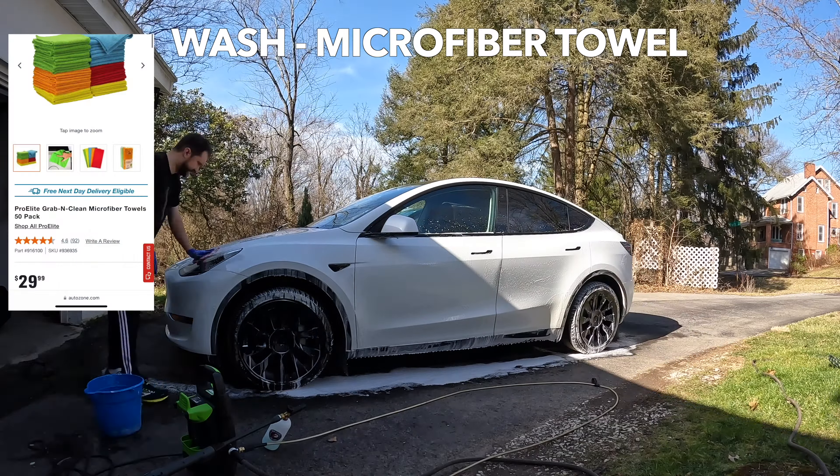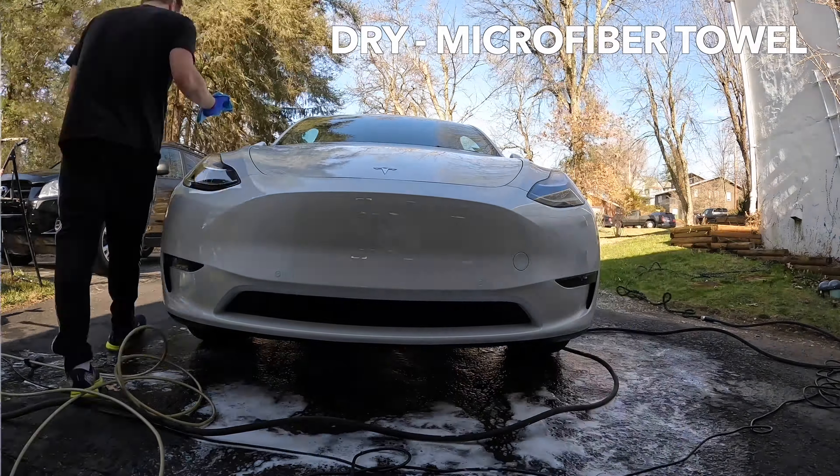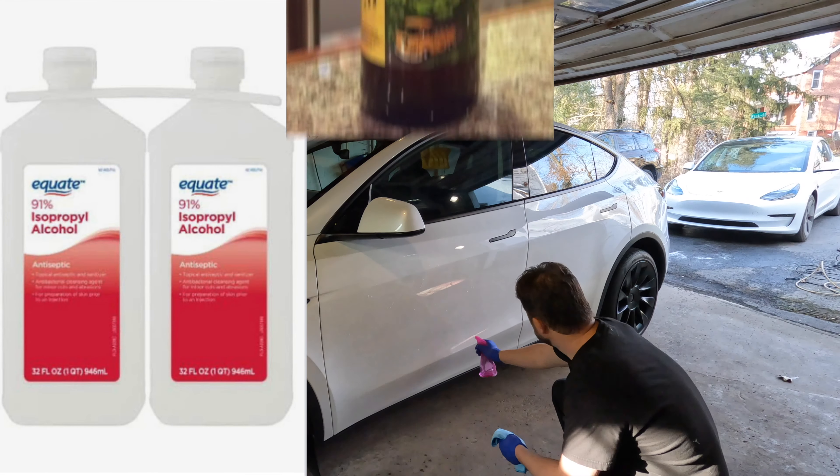Next, we dry the surface to prevent water spots, and it's the same procedure with the rear and the panels on the other side. But with this side, I'll skip the pressure rinse before the clay bar, which you can do if the vehicle isn't very dirty. This car was clean just a few days ago, so I'll be okay. I'm continuing to use the spray bottle so my clay bar glides across the paint, and I'm kneading the clay regularly to prevent redistributing contamination on the clear coat surface.